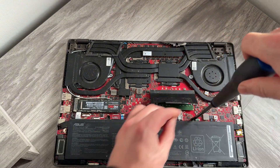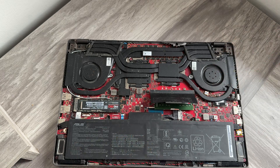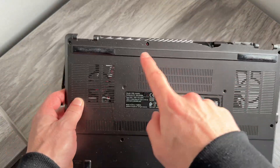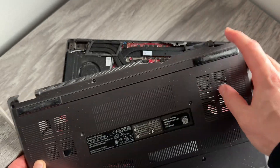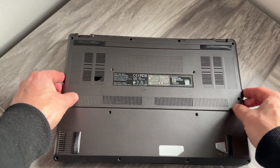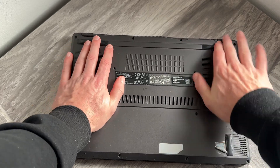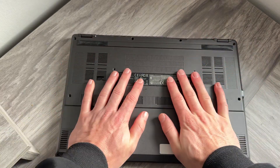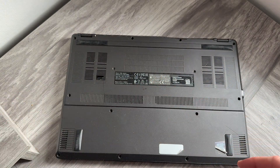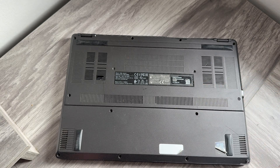Take the three screws and screw the battery back into place. Once the battery is secured, grab the back cover of the laptop, make sure it's facing upwards, and align the gaps on the top left and right hand side with the wedges on the back of your laptop. You can see it fits perfectly between the two wedges. Press down on the case firmly until you feel the clips snap back into place, then re-screw all the case screws back in one by one.